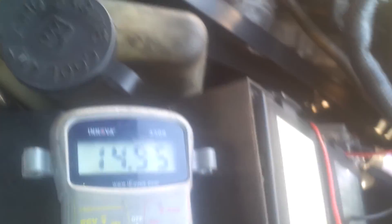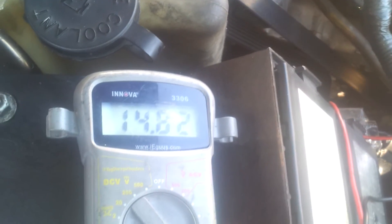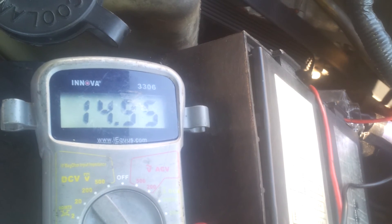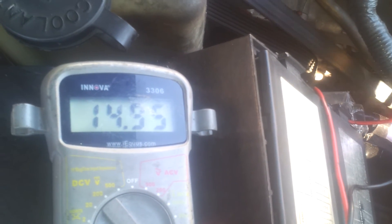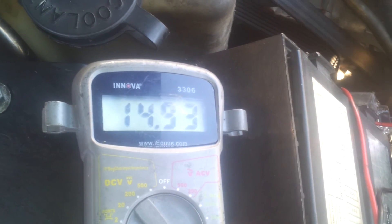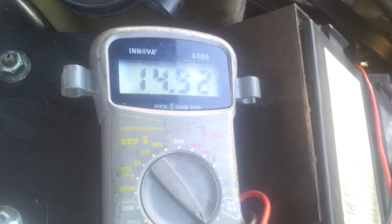This is just a test I'm doing. I might do it to my high output alternator — not sure yet. But this is the final conclusion: got everything set up, using my old alternator as the dummy alternator to do the test on. Voltage is at 14.9; usually I have 13.6 or 13.7 when it's all warmed up. I'm going to drive it around for the day and see what it does. That's about it — this is the third and final update of the installation. I'll keep you guys posted.